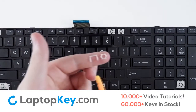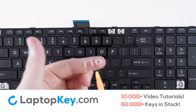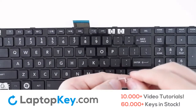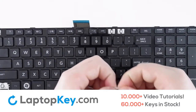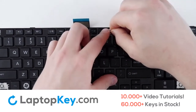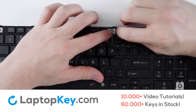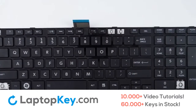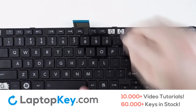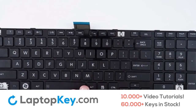To reassemble your clips, have an opening on the bottom of the bottom clip with a divot facing downward, and divots on the top clip both facing downward. Assemble the clip and hook from the bottom. Push the side in, firm press down, replace your rubber cup if necessary, replace the key cap with a firm press, and it's functional.